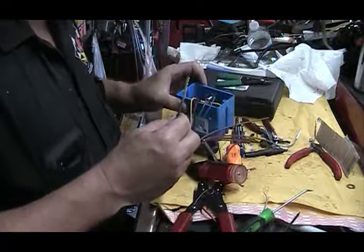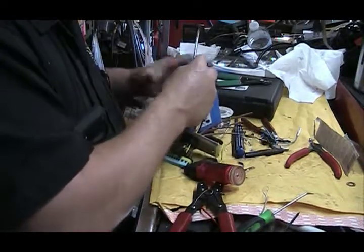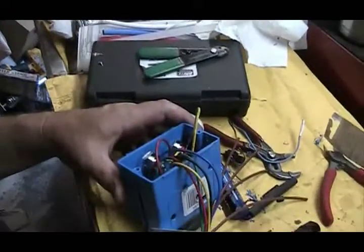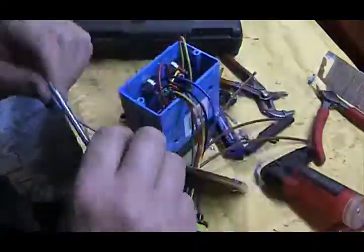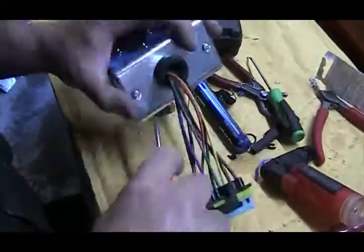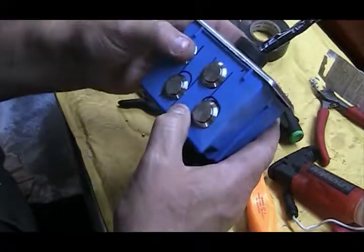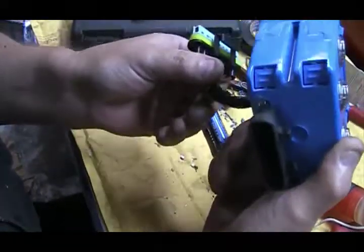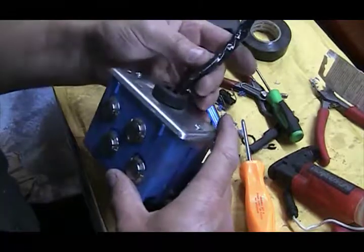So each corresponding color — green's the second one in, that one goes down in here. One, two, three, four — as you plug it in, they should kind of go in an S-shape, because those harnesses by this time on the 7.3s are getting pretty hard. And we'll go try it.